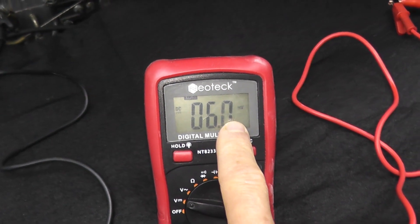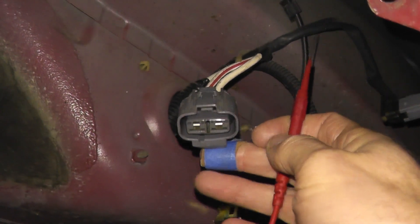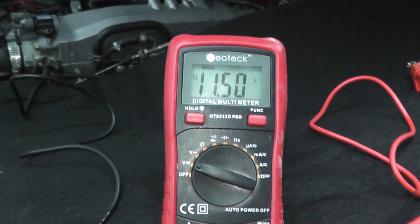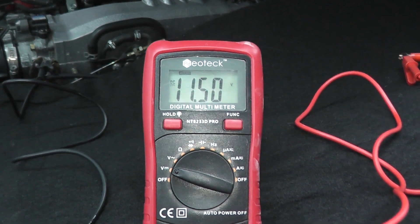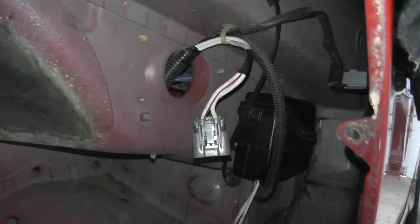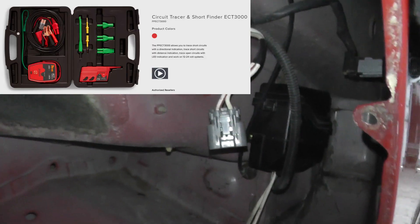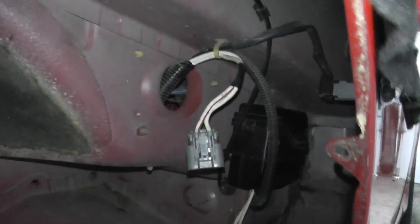We want to see battery voltage. Nothing on the first terminal, so let's check the other one. Now we do have battery voltage reading at the multimeter. If you do not see a reading here, you have a break between that wire harness and the fuse we just checked. One of the easiest ways to find any breaks in the wiring is a tool called Power Probe — I'll include a link in the description. It makes it incredibly easy to find any shorts or opens.